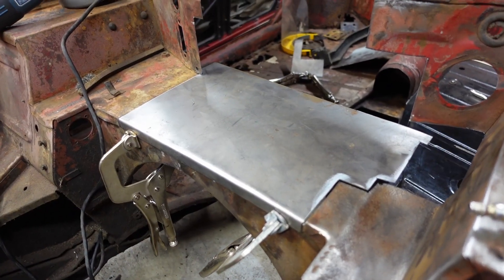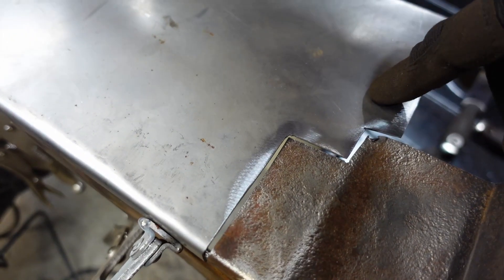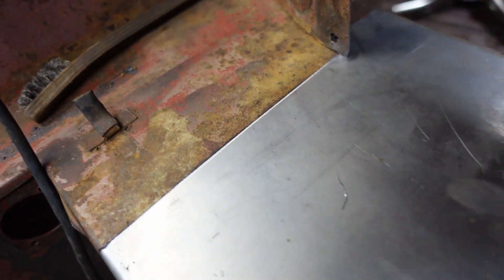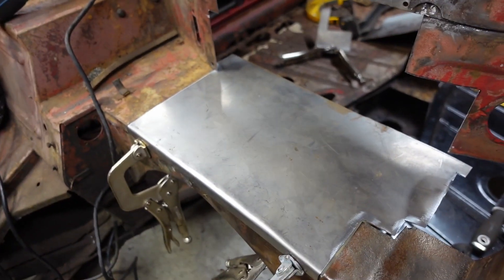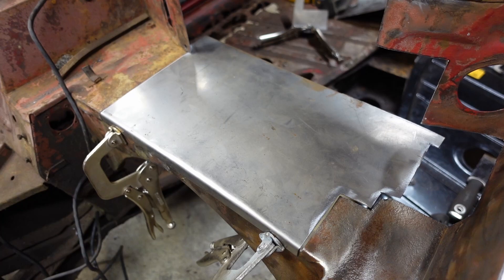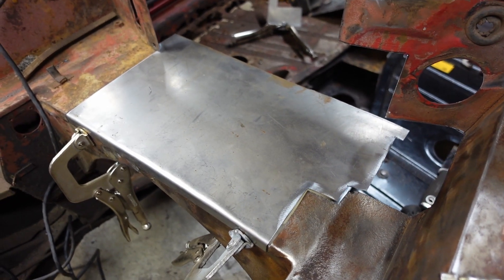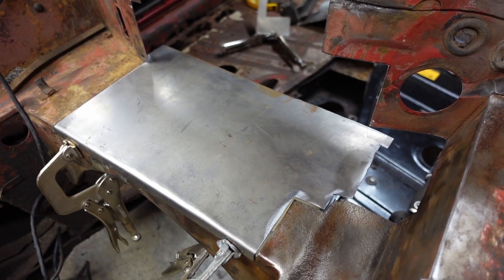Not my best work, but not too bad — it's on there pretty well. The flange here in the front is a little bit long, which is absolutely fine. These gaps in here are a little bigger than I want them to be, especially this one. With all the pitting and everything, I'm hoping I'm not going to have too many problems. Over here the gap is good, so I can probably steal a little bit from there and slide it over. With the ribs yet to go in, that might change things a little bit. The metal should stretch and not really deform so much. If I have problems with that, I'm going to have serious problems elsewhere. I'm going to leave this in and start fitting up other stuff and see if I can get some semblance of what the final product is going to look like.